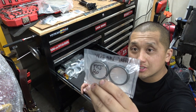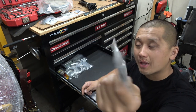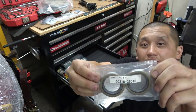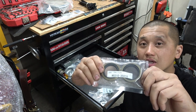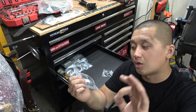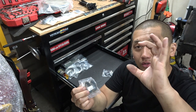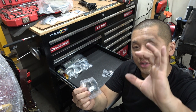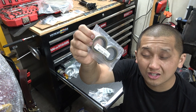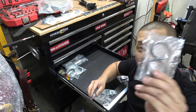These are the rear axle seals OEM — I keep two of them zipped into a packet. These are the front axle seals for the 80 series. If you have an 80 series and you do your axle seal rebuild, use only the OEM — don't use Trail Gear, don't use Marlin Crawler. They will leak because they cannot handle the full-time all-wheel drive that the 80 series has. The OEM seal works like a little gimbal — it always moves with the axle. Part number 9031035010 — they cost about six bucks each if you know where to get them.